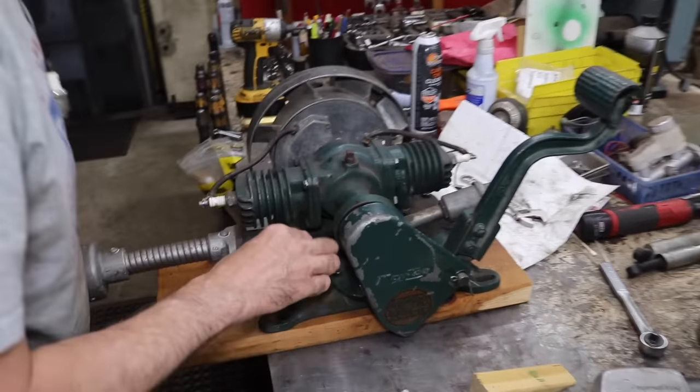So I thought there was a little hole in there, but there's not. It appears that it's got a little check valve. So I sprayed some cleaner in there and I could hear it going through, so it's going through the hole. So now I got some gasket paper. I got a roll of this. And I'm gonna make a gasket for this gas tank. And I'll show you how I do that.